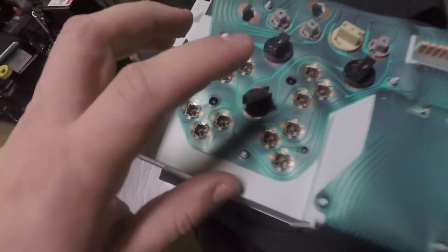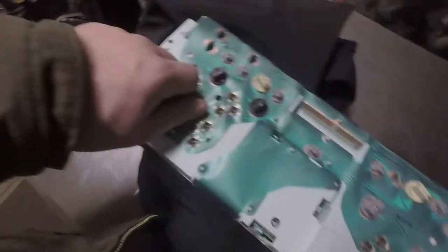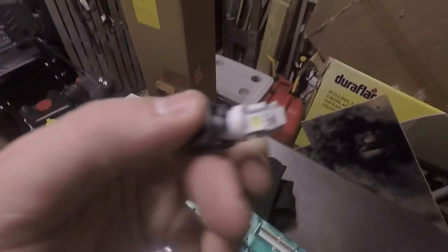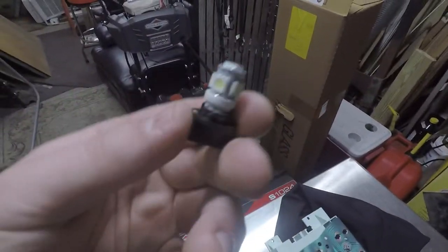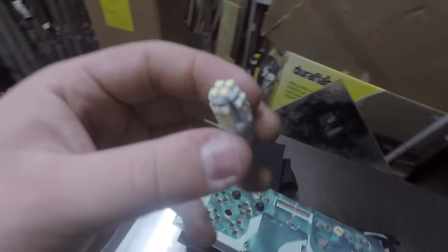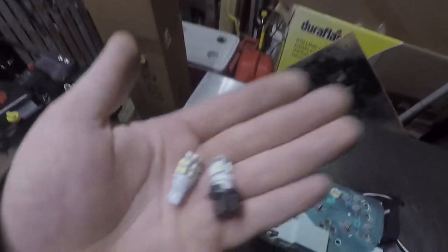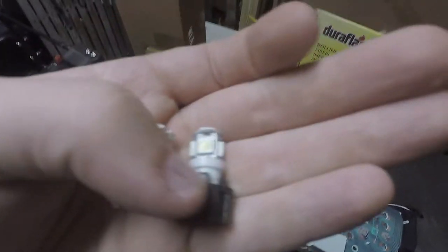All you're gonna do — these three black ones over here, one, two, three, and then these three gray ones right there, one, two, three — you're gonna just twist left and pull out. These are the bulbs that I had in there; they've been in there probably since 2014. These are the ones I'm putting in. The difference is a little noticeable — a second stack of LEDs, so four individual LEDs compared to one bigger one on each side, so they can be brighter. I just dropped that — don't do that.